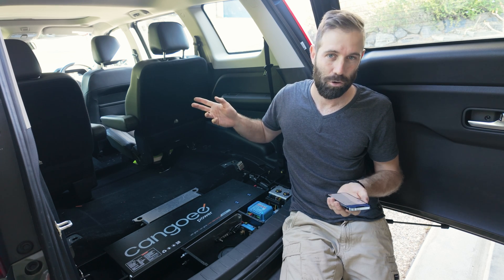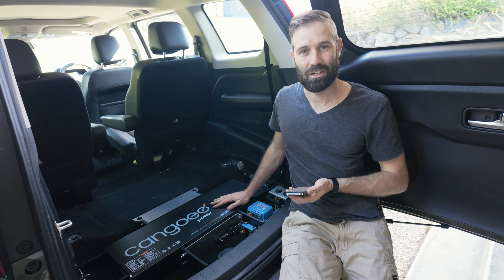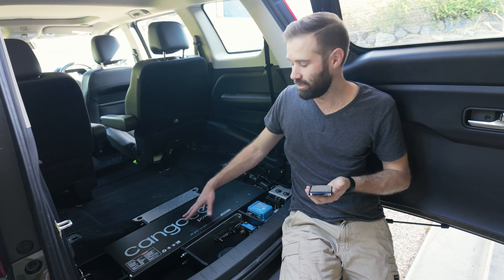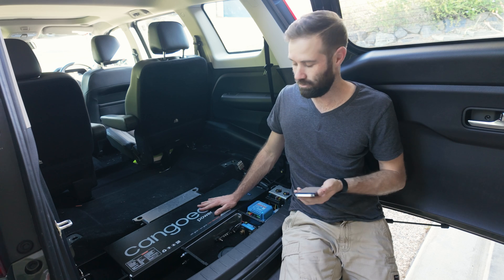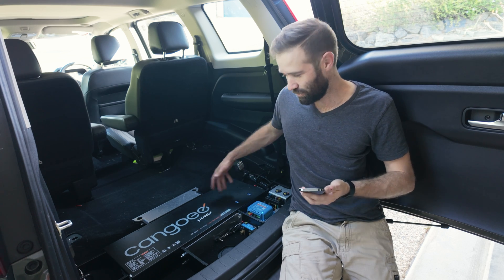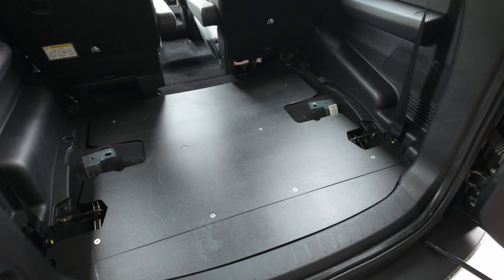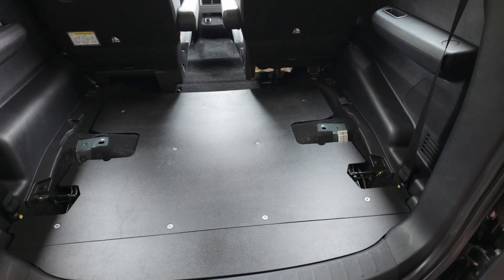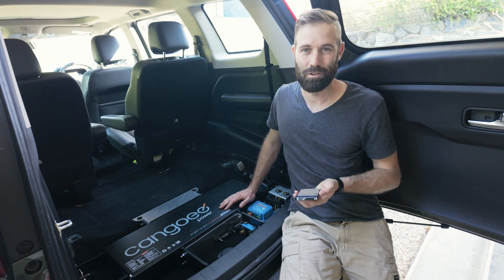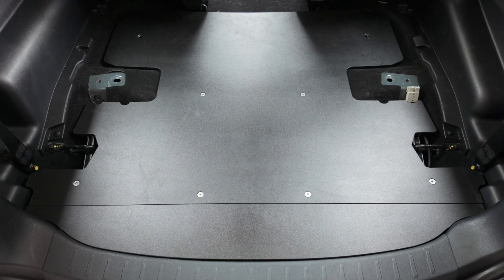With a 40 amp DC-to-DC charger coming in from the engine and a 200 watt solar panel on the roof, I think this will be a fantastic charging system for charging cameras and running fridges. Down the track, 110 amp hours might not be enough for extended stays, so I'll probably end up getting a second 110 amp hour lithium battery once the drawers are installed. But for now this is a fantastic solution for anyone wanting to run a fridge on the weekend or for a camping trip, and with that Rybuck false floor it'll all be contained underneath — giving you full boot space. I'll get the false floor put back on and see you in the next one.